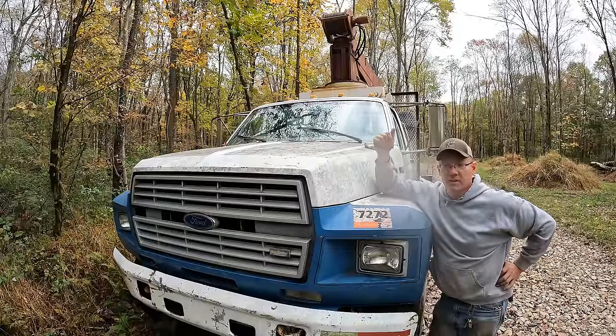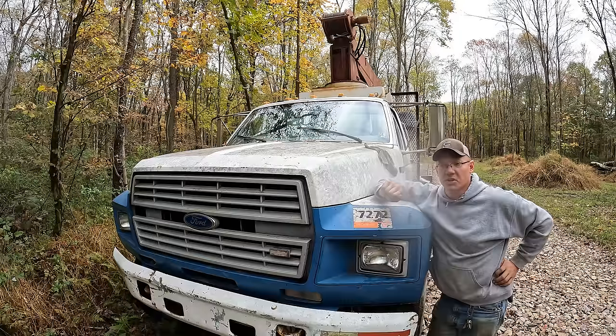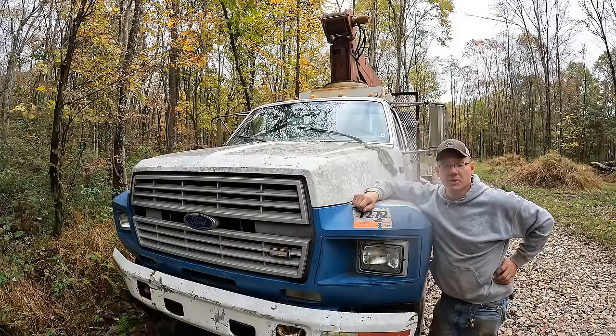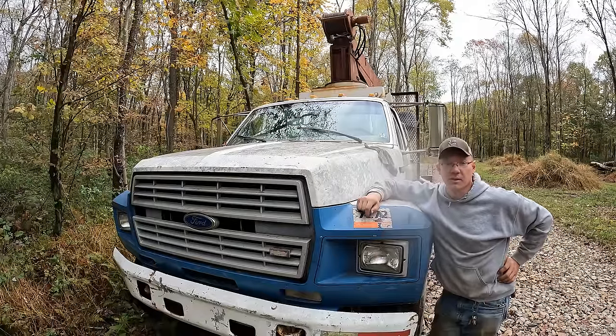There is a hydraulic cylinder inside of the boom that extends the boom, and in certain positions it leaks hydraulic fluid, and you'll know it because all of a sudden it's got hydraulic fluid dripping out the end of the boom while you're trying to lift something. So ideally that's something in the future we would tear down and figure out why that's leaking. I'm imagining it's either a scar on the chrome or just the packing's blown out, but it doesn't make sense why it would only do it in one position if that's the case.